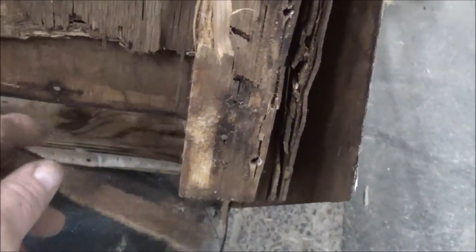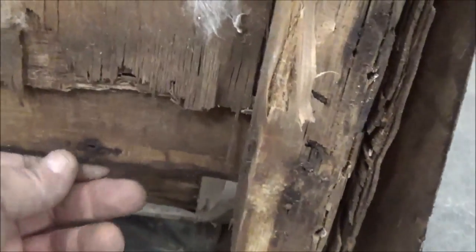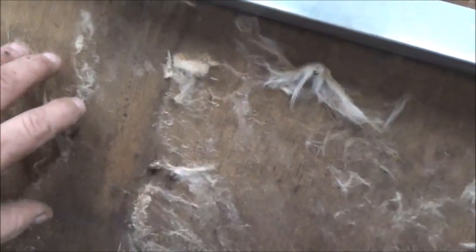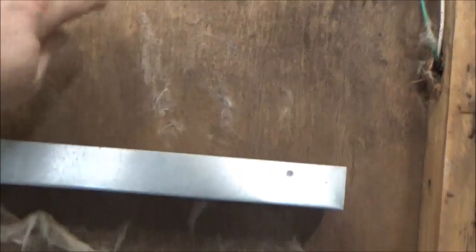That's the paper right there — on the other side of that thin thin layer is the interior finish. On other ones we've laminated and glued in a piece of rigid foam, which gives it a nice strong backing, and then you don't have to tear and replace the whole wall skin. It's only an eighth inch — it's just meant to hold the paper. There's no strength to it, so why tear all that paper out? As long as the rot is out of there and it's rigid enough, that's pretty solid — no reason to start breaching into somebody's wallet.